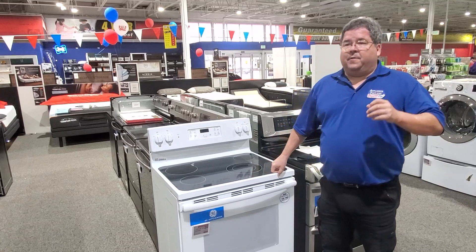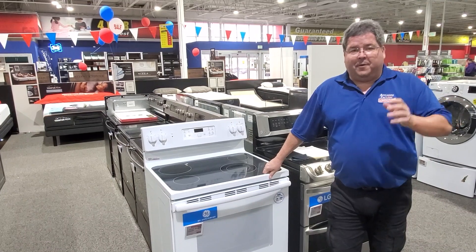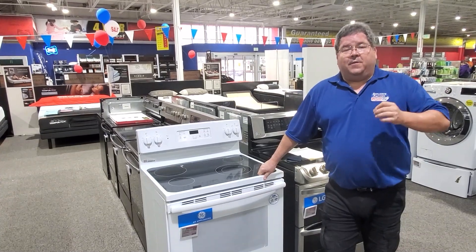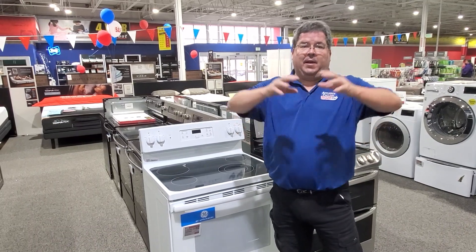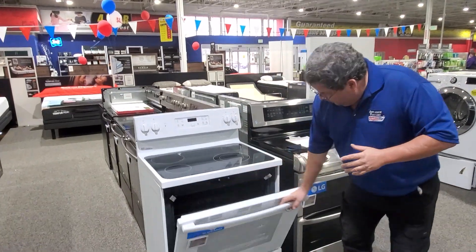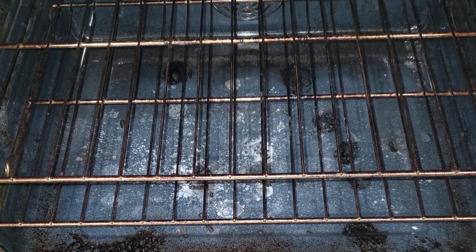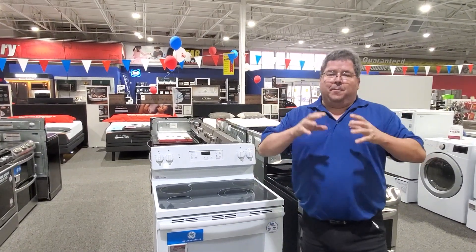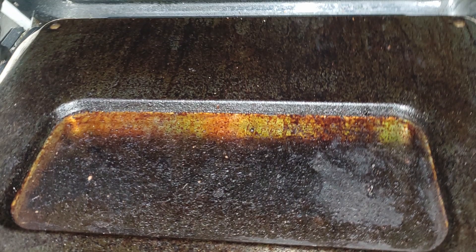Now, this is also a good time to find out: does my oven need to be cleaned? You want to make sure your oven's clean before you bake, and second, is it going to have an issue with baking? A lot of these ovens have what's called a thermal fuse. As the oven packs on buildup in there, that fuse gets a little weak and actually goes out, which cuts off power to your oven — which means you can't bake.